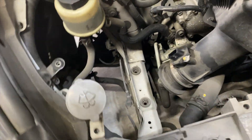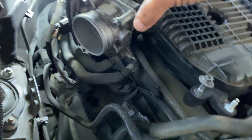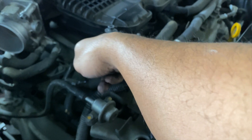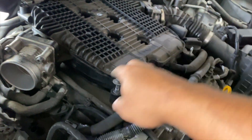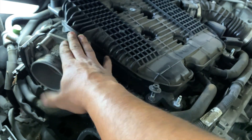In order to get to the number five coil pack, it's actually right up under the throttle body, so I had to take off the intake tube, the air box, and this front radiator cover cowling just to get to it. Now I have to pull the throttle body off just to get to it. Cylinders one, three, and five are on this side, and two, four, six are on the other side. The one I need is always going to be in the hardest spot, which is number five, up under the throttle body.